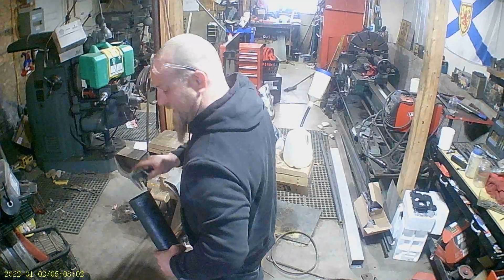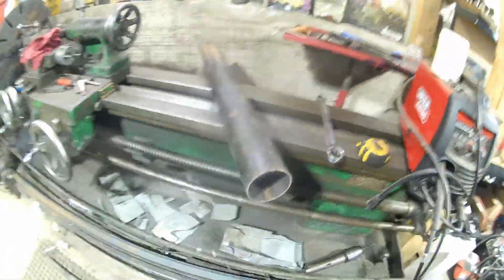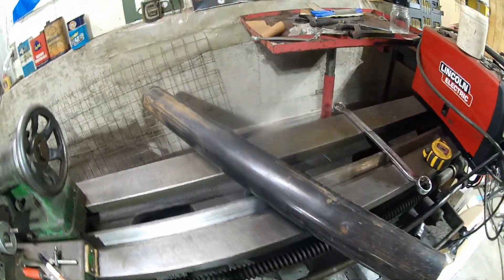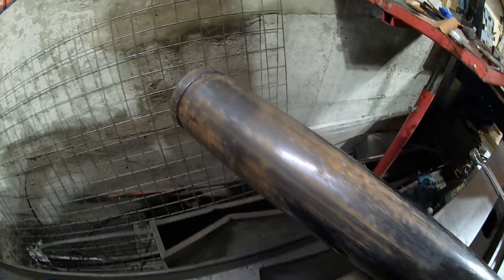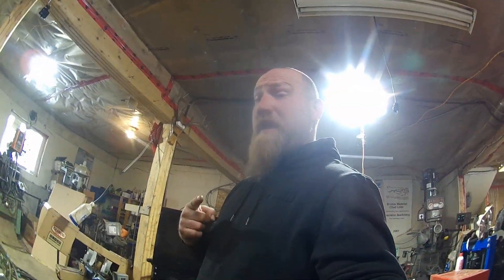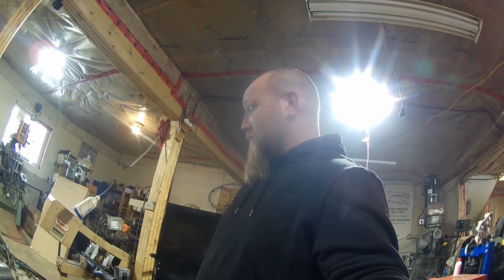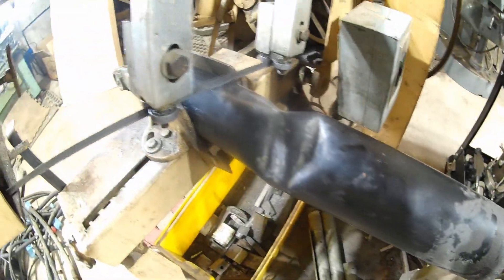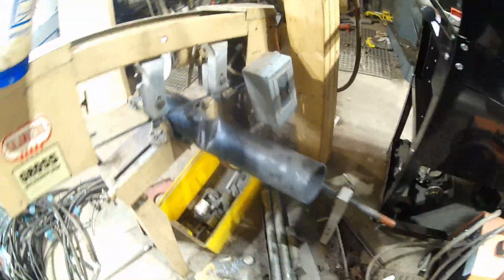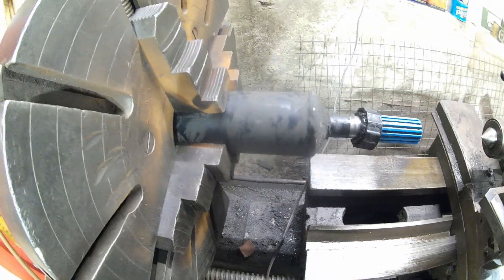Looking at 88 thou wall thickness. We have our new material — it's a little thicker, we'll have to bore that out. And for some reason it has this indentation on the end so we're going to have to cut that off, but we've allowed for extra length so we should be good there. Now we're just going to get in to finish cutting off this gnarly piece and then we'll get them both in the lathe and get the ends turned off of them.